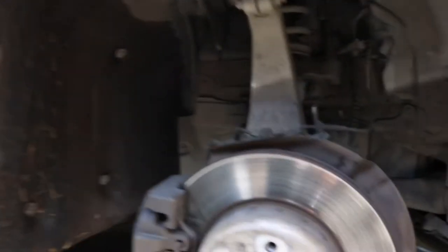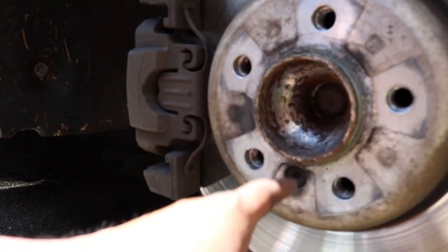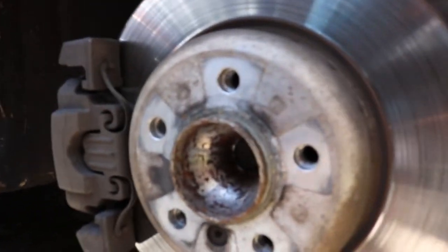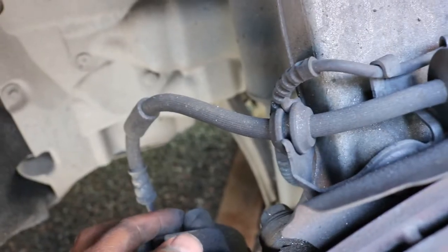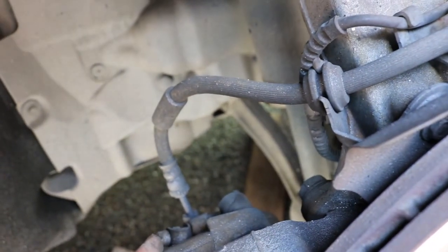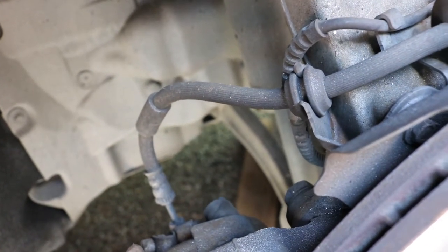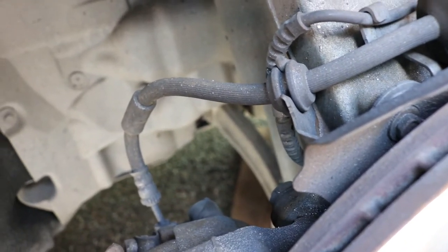All right, so I removed the tire. I already put it right there just as a safety. The rotor is gone. Brake pads are gone. I have to remove this first. Okay, so I need an 18 in order to remove this right here, and I believe I need a 12 for this one in order to remove just the pistons. But apparently I have to go get an 18 and a 12. So I have to go spend more money on this project. I'll go and get them after I go pick up my kid.